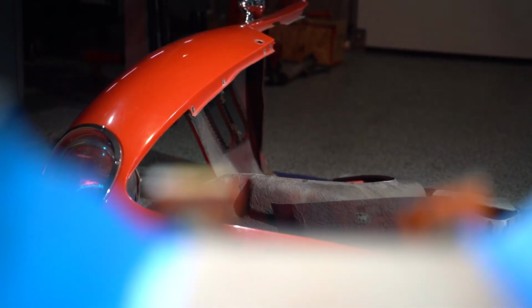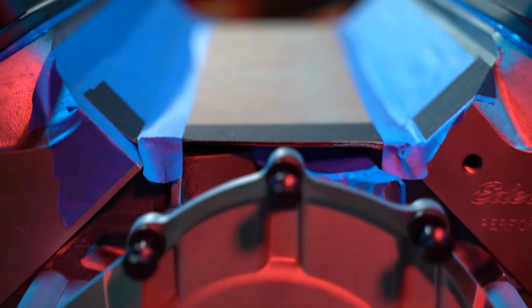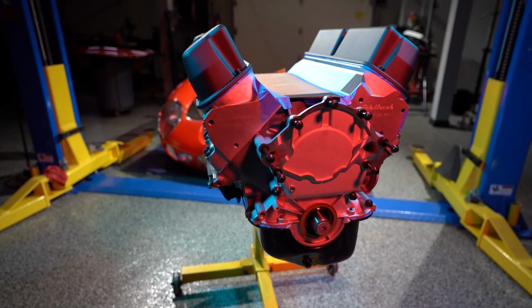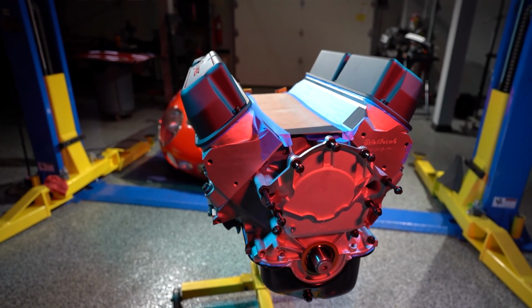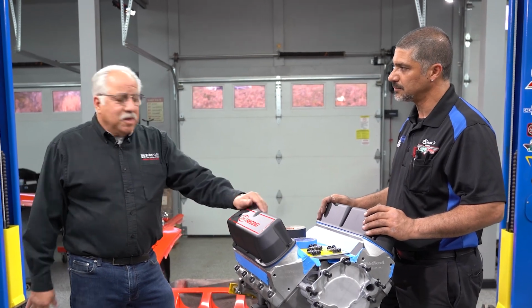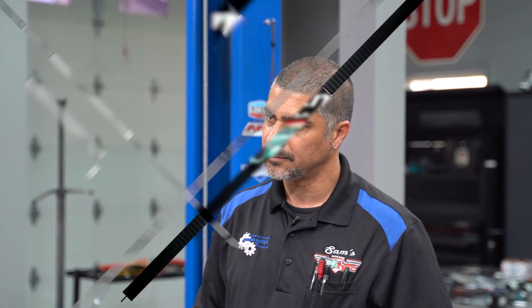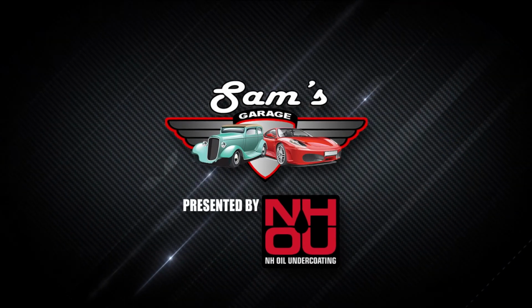And we want to make sure the intake manifold that we use is going to give us a European flair. Right, yeah, we're going to be looking at a fuel injection system onto it, using throttle bodies, a Weber type setup, except it'll be fuel injection. We've got to measure all of our heights, make sure everything fits correctly under the hood, use the right type of fuel management system onto it, but it's going to have a really sweet look for a 250 GTO running a Ford motor.